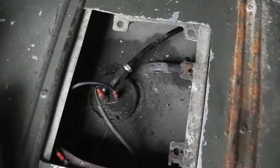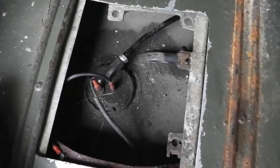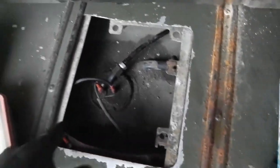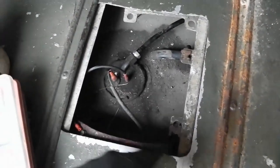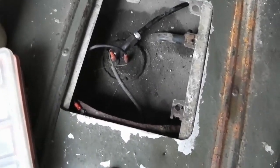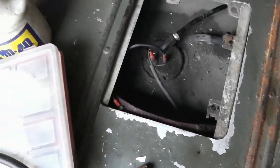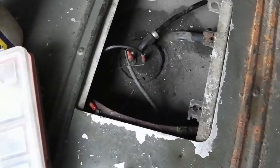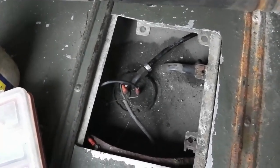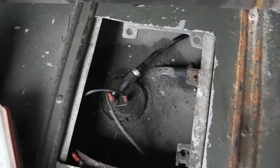It's a little bit grubby under there - I'll get the hose pipe in there and flush it all out at some point, but it doesn't really matter. One of my jobs is to give the floor a bit of renovation - I need to take it up and replace these braces. They're not too bad but they're a bit rusty now. One thing I'm going to do today is just replace this earth line and put it somewhere else so that the sender's got a good earth, as it is over-reading at the moment. But no leaks from the fuel pipe - all good.